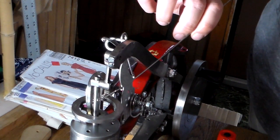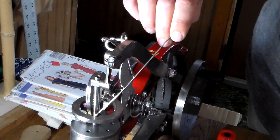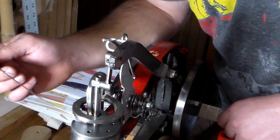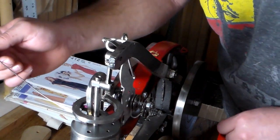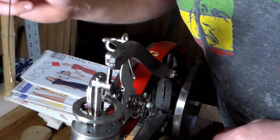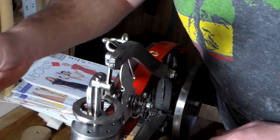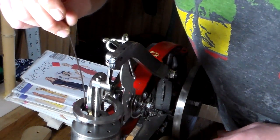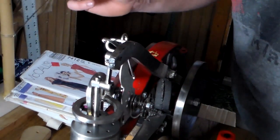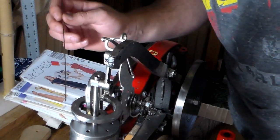Also, I will put a drop here, here, and here all along this needle driver and allow it to run down the needle driver. And also on the presser foot bars as well. There's actually two pieces of metal in here. There's 1 and 2, and I like to put oil all along this here so we can get it while it goes up and down, and also in between the two pieces because they actually rub up and down against each other. So that's another frictioning point that I like to put oil in.